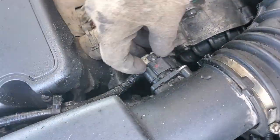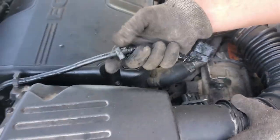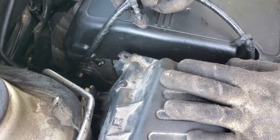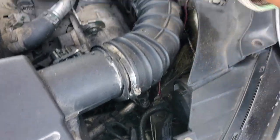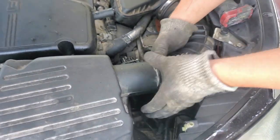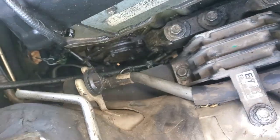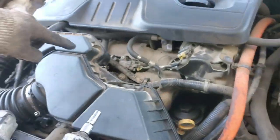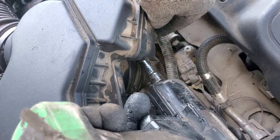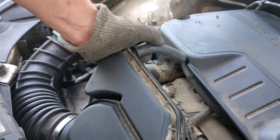So those are your two most common reasons for shredding belts on these cars. To get started replacing the tensioner assembly, we first need to get some things out of the way. I disconnected the mass airflow sensor, popped out one of the retaining clips, and using a 7mm socket we loosen the clamp to remove the air duct tube from the air box. There are two mounting points for the air box — one in the back that was broken on this car, and one in the front by the frame rail.